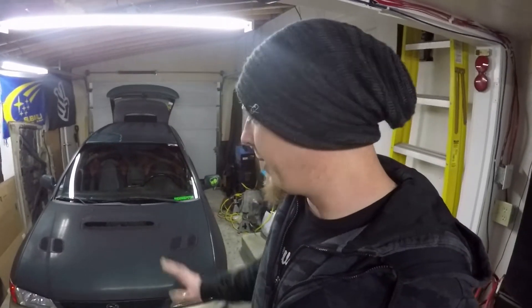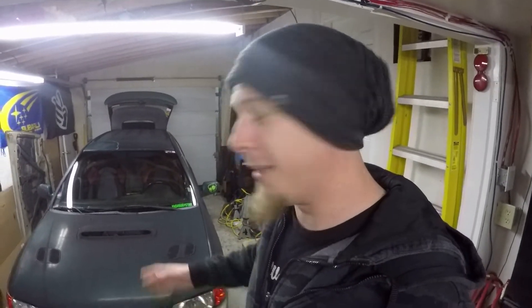What's up everyone! As you can see, I've gotten cars moved around. I finally have the old Impreza Outback Sport inside. This is the car that I ended up putting the single overhead cam EJ257 engine into. I drove the car for about a year and a half — the engine was really strong, it did blow a little bit of oil and was definitely fueling rich. This car is basically coming off the road; eventually I'll put the engine from this car into the red one. Number four cylinder definitely had low compression with a cracked piston in it. All I basically did was put in new pistons with rings and slapped on some 251 heads with gaskets.